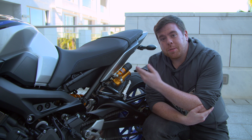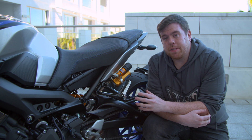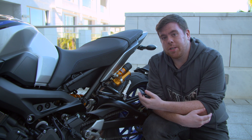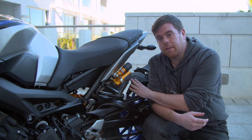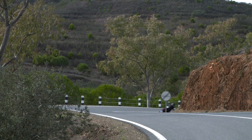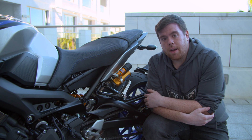A point of note is that the spring rate for this Ohlins shock is actually slightly softer than the standard MT-09. This might seem strange considering this is a sporty machine, but it gives us better road holding for the rear tire. It's the high quality and the adjustability of the damping circuitry that allows the bike to have better road holding and more control for the rider.